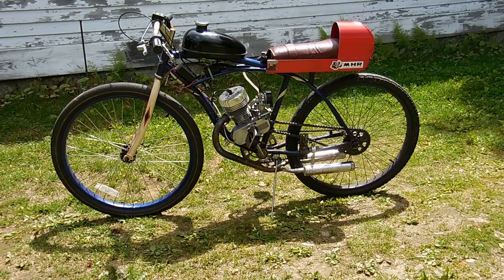This engine produces good torque. It's built on the Super Rat bottom end — a 40 millimeter stroke engine. I must warn you though: of the approximately 10 Super Rat engines I've received, about 60% are unacceptable. They are going to be disappointing, and some of you who have purchased this engine will probably be scratching your heads about why performance isn't good. The reason is the connecting rods are bent.